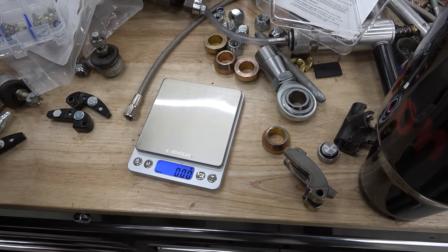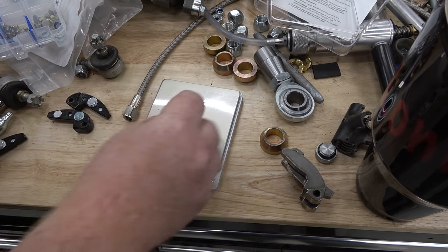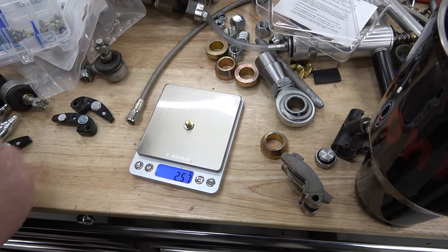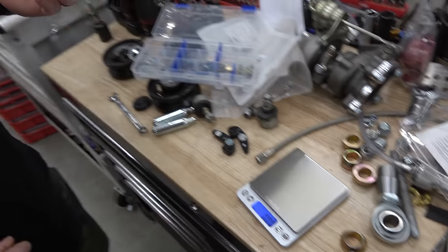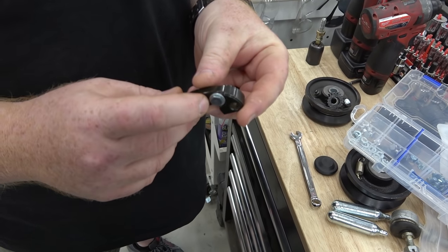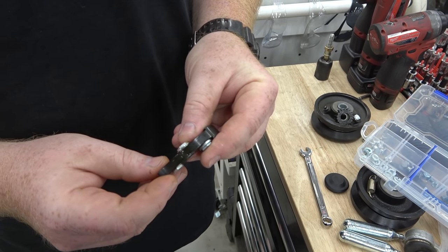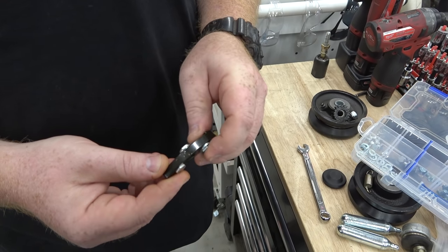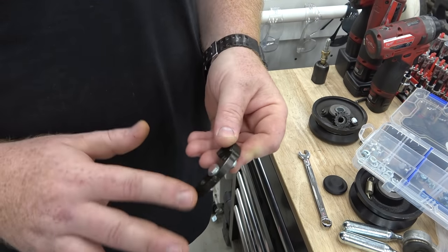The light bolt, this is aluminum, is 3/4 of a gram, let's say. The medium bolt is probably 2 grams, I would imagine, and then 2.5 grams for the heavy one. When we talked to Dirty Dog, the owner's a super nice, super cool guy, and he'll explain everything to you. He told us to go with the medium bolt and thick washer at the heel. In the center, we went with an aluminum bolt and 2 thin washers. Then we went with 1 aluminum bolt at the toe. The heel is going to give you takeoff from what I understand, and then you get takeoff, mid-range and top end, kind of, sort of.